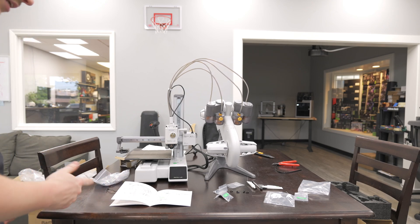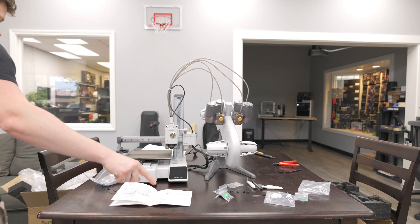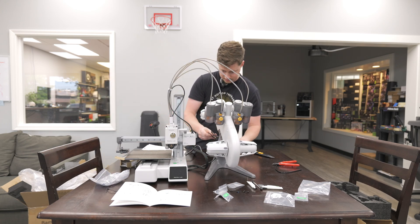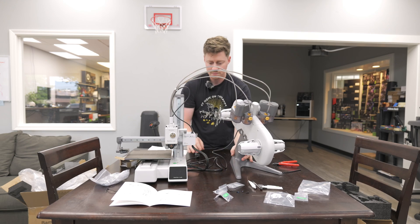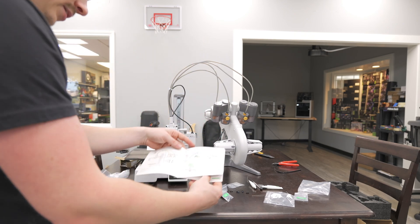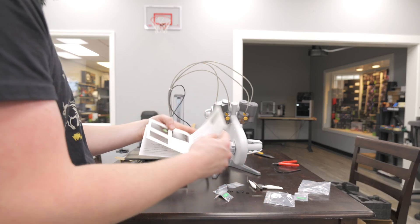About this distance — they give you a measurement of 50 millimeters. Now we've got to connect the actual AMS to the printer, which is going to involve undoing one of these little zip ties. They actually give you two slots, so a lot of these can take more than one AMS. You can just plug it into the one that's closest to the front of the printer.